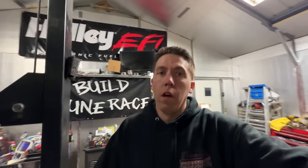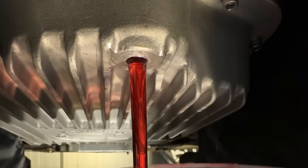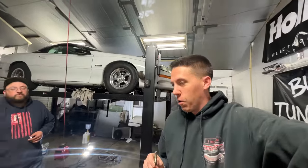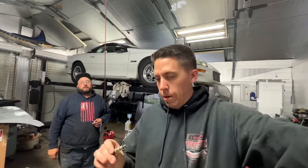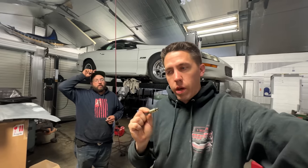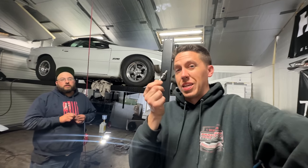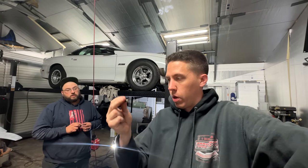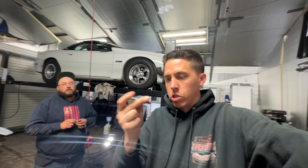Well guys, Salty is back in the shop. Unfortunately I drove it around — I unhooked the trans brake. It feels like the trans brake is trying to drag it down, but it's intermittent, not consistent. Let it cool, dynoed AJ's truck, and now we're back on the lift. Getting ready to drain some fluid out of it and pull the pan to see what we see inside. Hopefully no metal shavings. That's what it looked like from the beginning — nice and clean. After a few hours of checking, looking, and verifying, this is the plunger that would go in where a trans brake would originally go. Well, this spring wasn't in there — it was just the plunger. And it has over a quarter inch of play. If this were to slide in, it would want to act like it's applying the brake and then come back out. That's why it's random — there's nothing actually holding this into place.